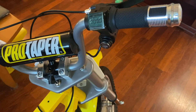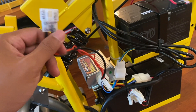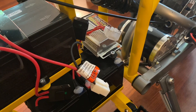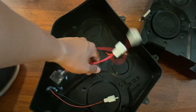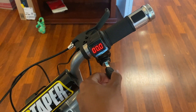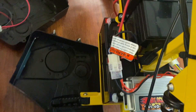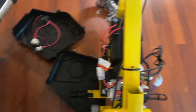Let's turn it on. We're pretty much all done with the electronics install and wiring except for the power source and the charge port - I'm going to have to look more into how I'm going to fit my fourth battery and how I want things positioned. According to the instructions, the power source plug from the controller is supposed to hook up directly to the battery and completely bypass the on-off switch, since it would be redundant with the circuit incomplete without the key turned on. I connected the controller onto the batteries and keyed on - now the circuit's complete and it's powered on, so having a separate on-off switch would be redundant. What I'm going to do is cut right here and run the fourth battery in series, and that should complete my 48 volt system.